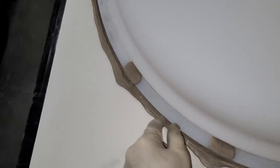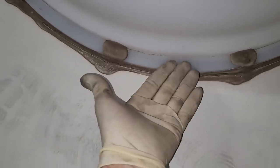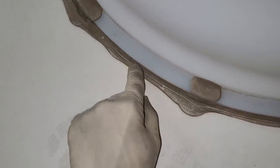Right here is probably the worst design skylight out there on the market. There's very little flange that actually seals down on this. It's not even flat underneath — it actually cuts back up and over, so this sealant right here needs to be resealed. I'd really like to reseal this entire skylight.